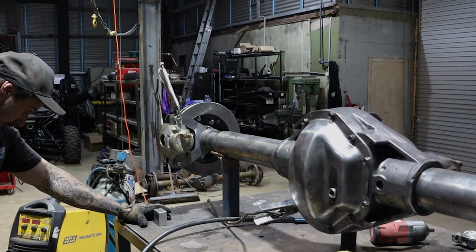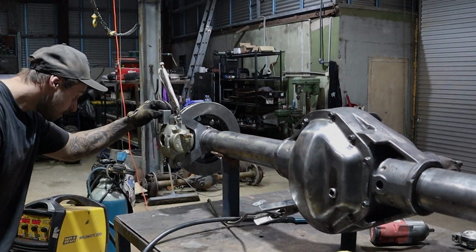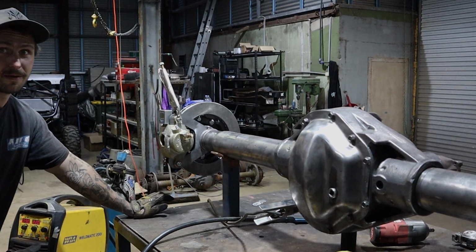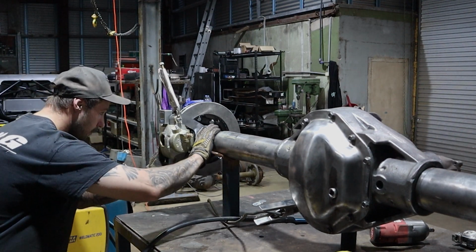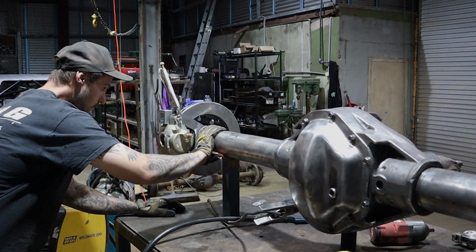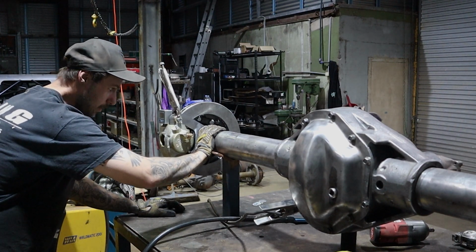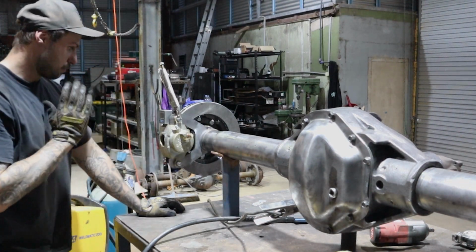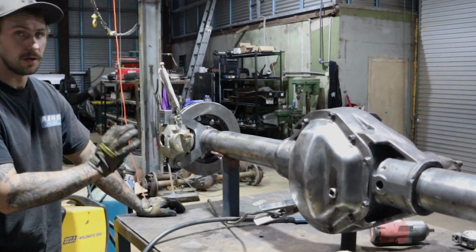But go back on the bench, that's 0. We'll chuck that on here, and it's 0.6 of a degree. Now that's not too bad for a tack. So all we're gonna really have to do is find where that's right there. So all that was a little bit of thumb pressure down the bottom here, and that's now housed it so that caliper is perpendicular to this housing and bang on.